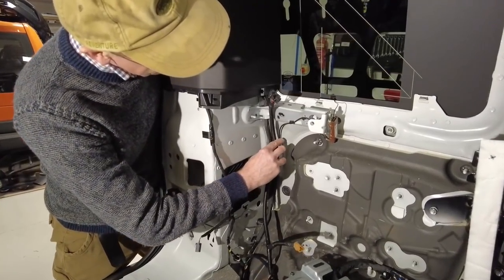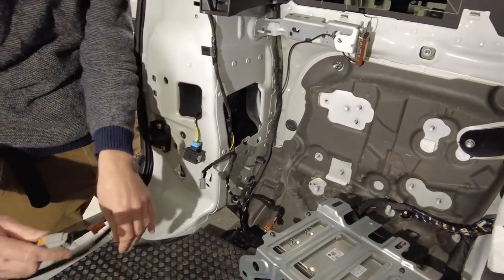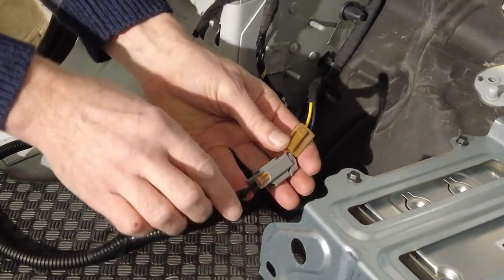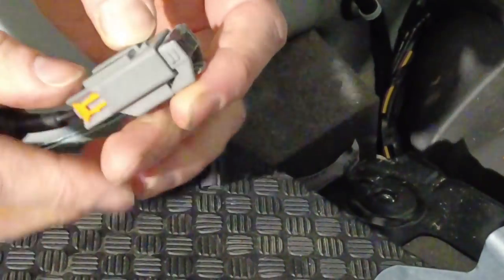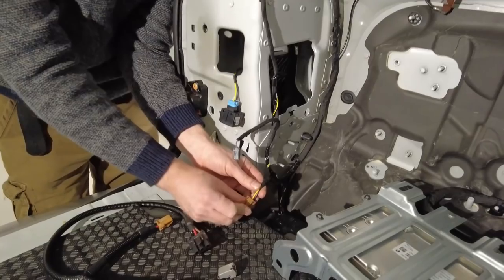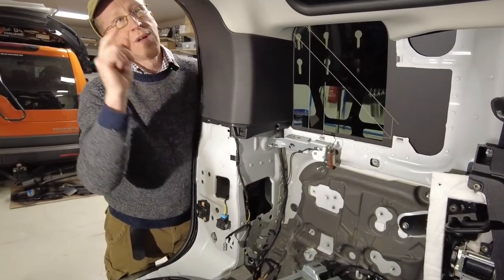We've got to remove this connector here and put the pins in here. We've got to make sure the black wire goes through to the black and the yellow wire goes through to the purply-brown one. While we've got all this out of the way, let's unpin this connector. Tyler — who's got eyes that work — is going to dexterously show us how to prod that and remove these two wires. We disconnected the battery — if you don't know how, I'll put the link to the how-to in the description. It's under your seat.